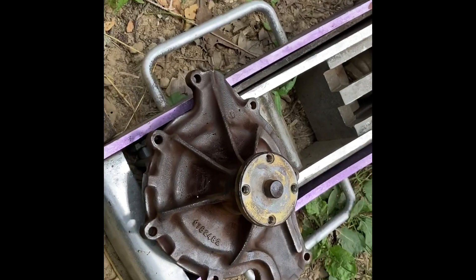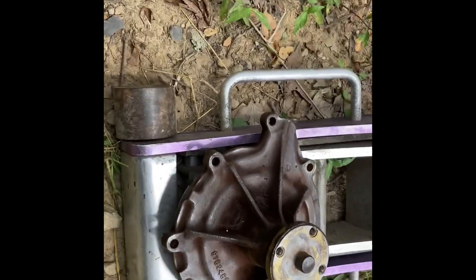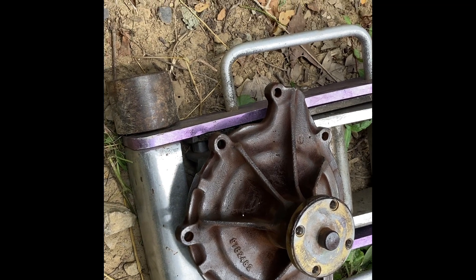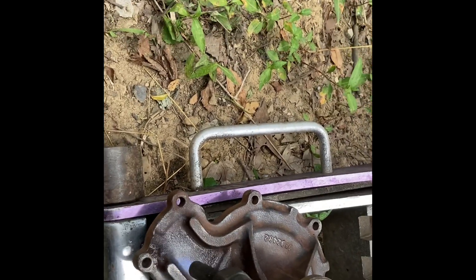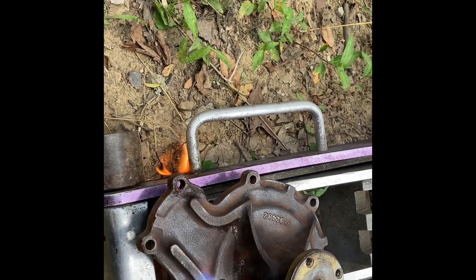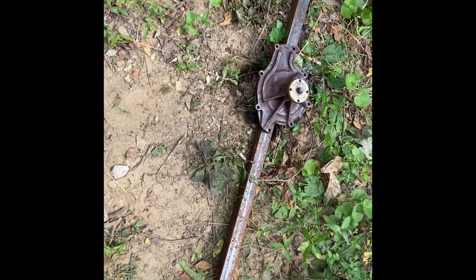I'm going to take some brake cleaner and a paper towel and wipe it down, then take the cutting torch and heat it up to sweat the metal and get all the oils out of it. I'll wipe it down again, probably one more time, heat it up, and then primer it. You can watch the coloration changes as it's sweating all that crap out — that's just the brake cleaner burning off. I went ahead and brake cleaned it again and now I'm going to sweat it one more time.